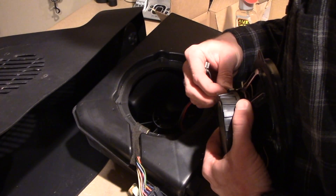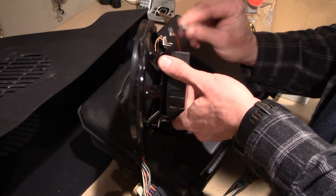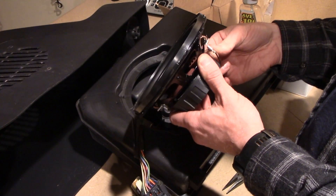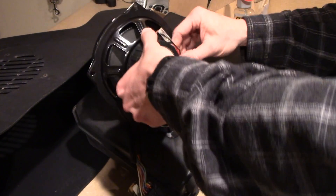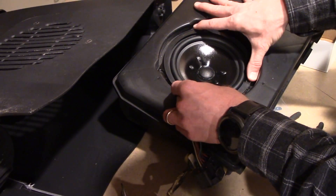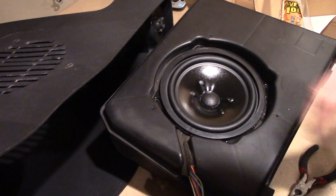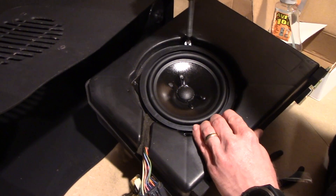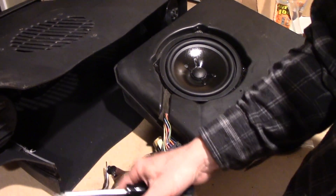After adjusting the terminals it's nice and tight and won't rattle off. Be careful putting this back on so it doesn't damage anything. This just drops right back down into place. They included these little washers that go on top — not sure if it's exactly necessary but we'll try it out. Get your washer on there and then hand-tighten these down. Do not use anything power-related because these are going into plastic and you don't want to over-tighten them.